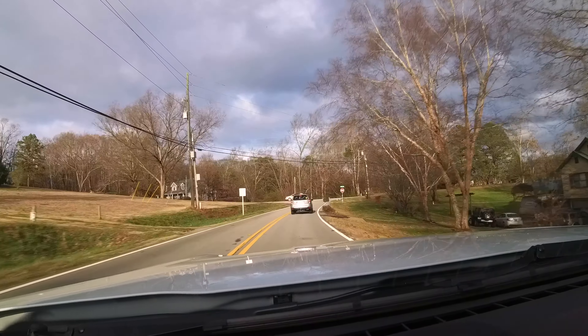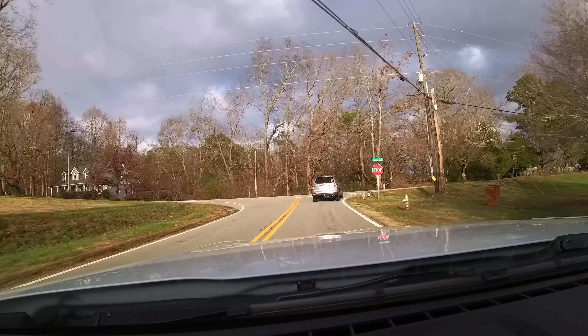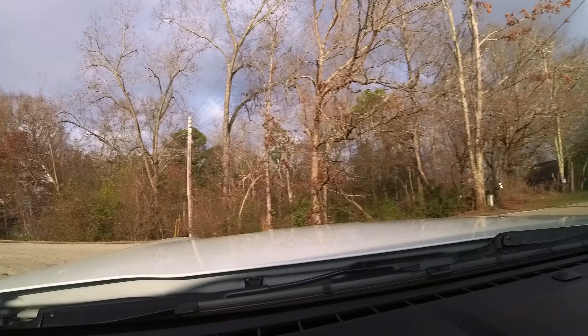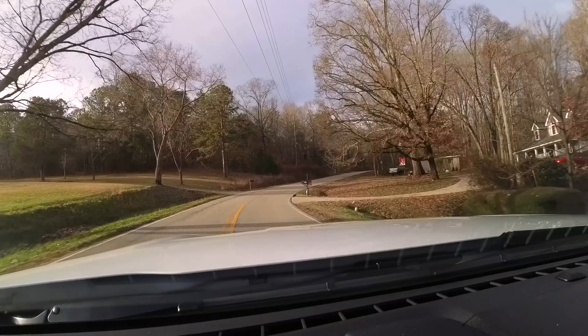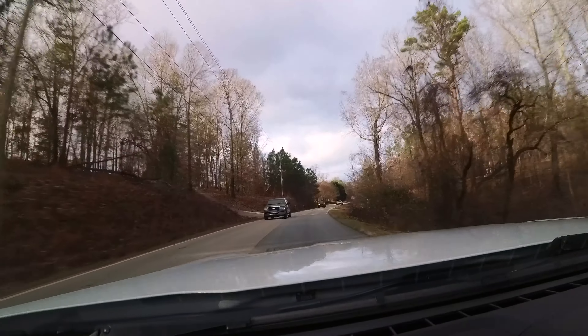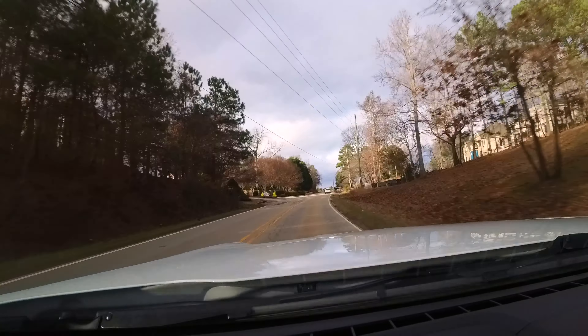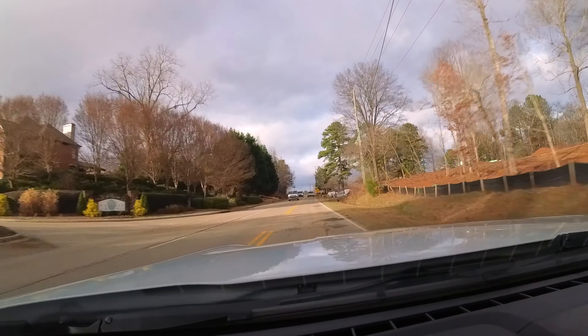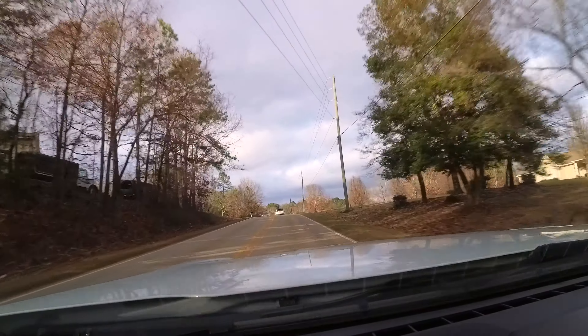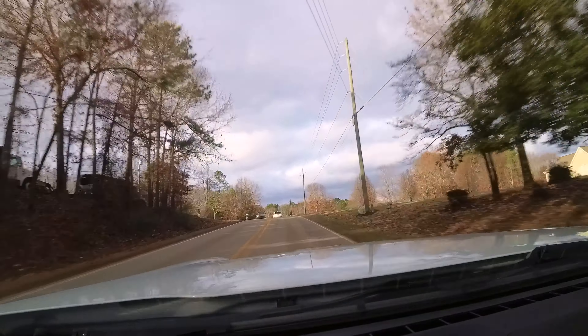At 37/37 front and rear, the front feels a little more planted — doesn't feel like the tire's moving as much. Even going wide open through the turn, there's no squirreliness in the back. These tires are great. They're not going to be as good as Michelin summer tires, but those suck in winter when it's 40 degrees, wet, and cold — hard as a rock. This is a good compromise, definitely a big step up from the run flats, but still good in cold weather.